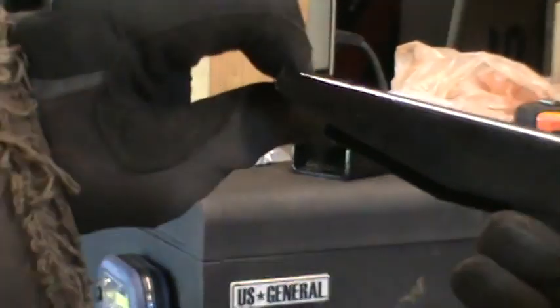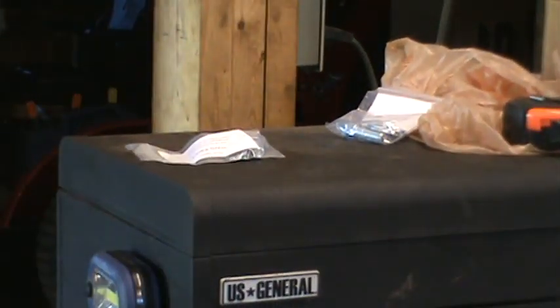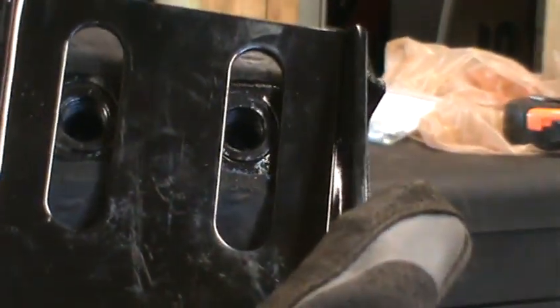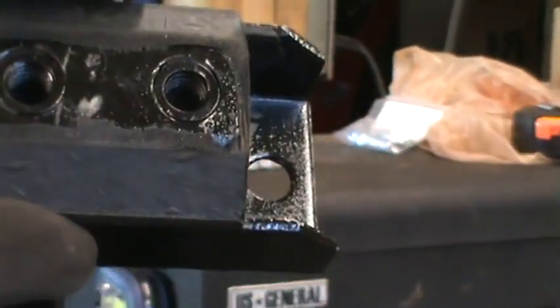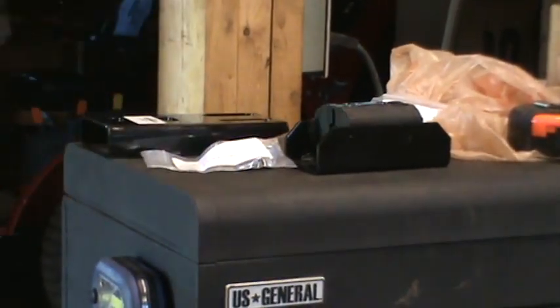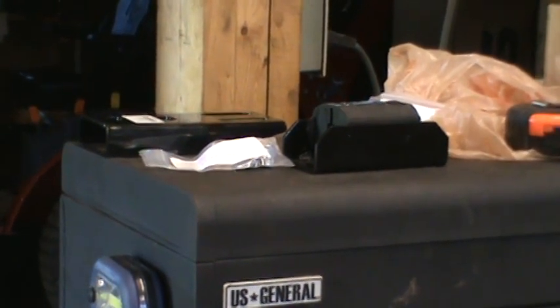So this cross member, the slanted part goes towards the engine. The reason I know that is I've lined up these holes in the mount with this side of the bracket. That is what fits. The other side does not. So this part goes underneath the cross member. So I'll get those two things bolted on first, and then we'll figure out how to safely lift the transmission.